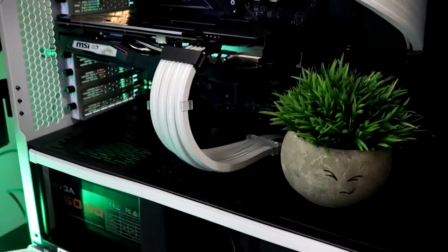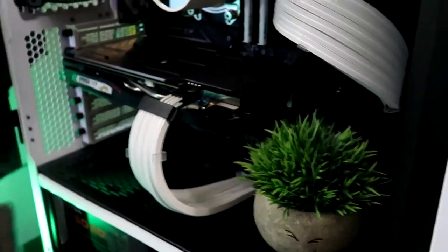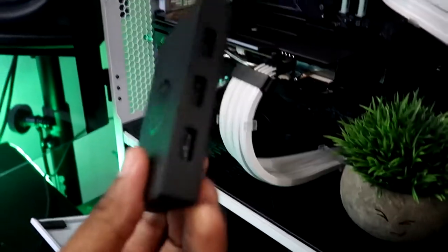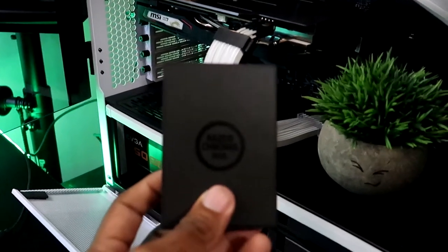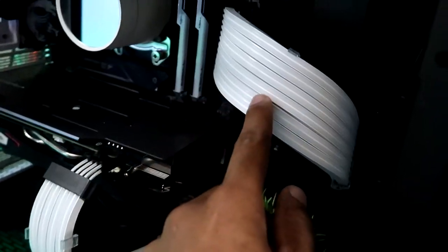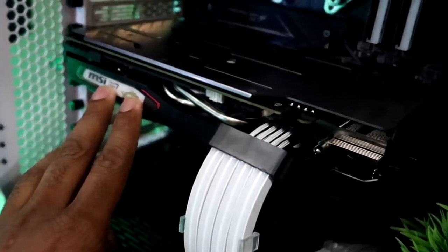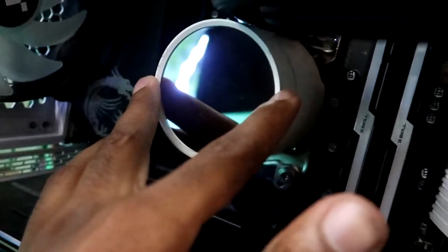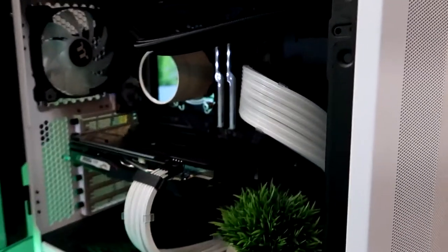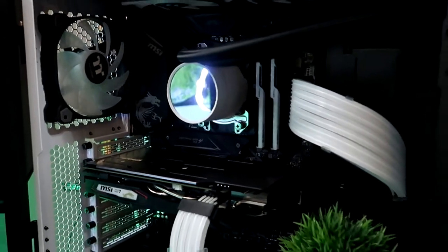Before we get started, I'm going to show you what I can actually connect to the Razer controller. For each single RGB port on there, you can only address a total of 80 LEDs, and 260 for the whole entire controller if I'm not mistaken. So the Lian Li cables won't be able to be connected because those have like 110 LEDs in one and 130 LEDs in the other. Obviously my motherboard and RAM won't be able to connect. But my Deepcool Radiator AIO and my Lian Li strip, as well as the three front case fans — sadly the Thermaltake fans won't be able to because they use a separate controller in the back. I eventually plan on replacing all these with dual RGB ring light fans. I don't care, judge me, I'm an RGB fanboy.